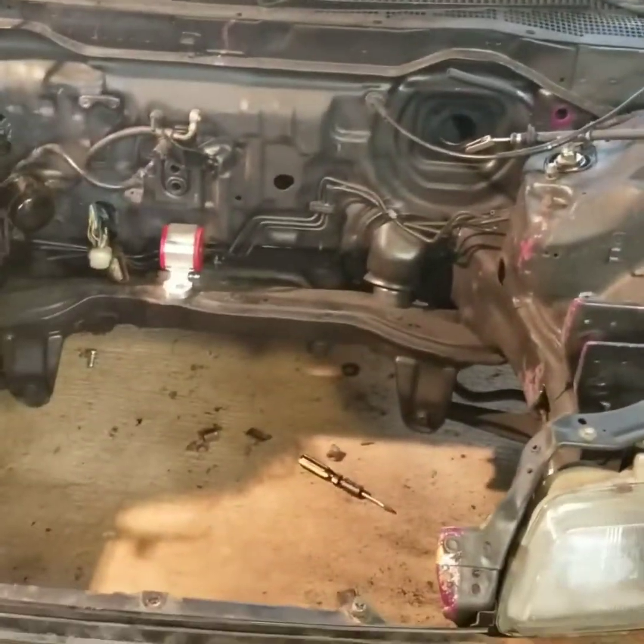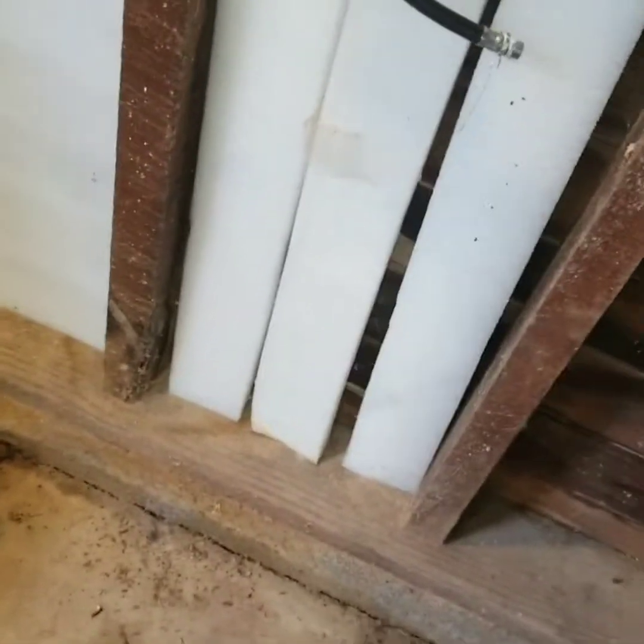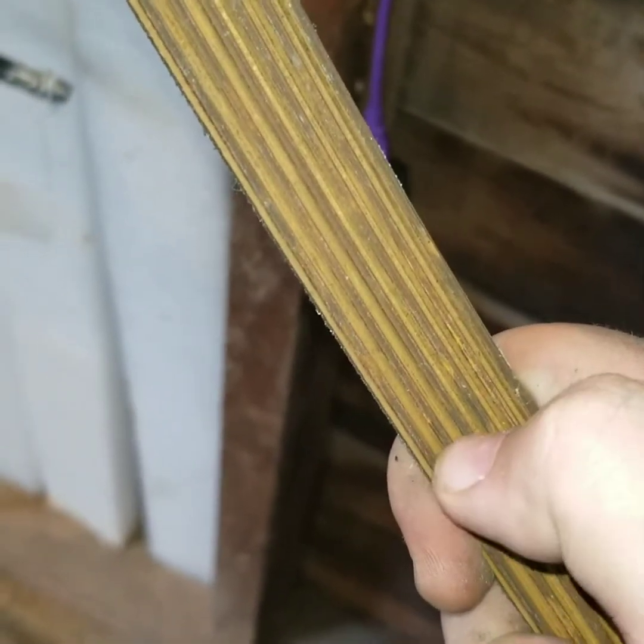No problem. I am ordering a VMS S2000 crank pulley. So that's actually thinner, I believe. It's a four rib. And we got the belt for this one over here. And this one is, focus, 1, 2, 3, 4, 5, 6, so we got 6 ribs. So 2 less ribs should be tucking a little bit closer to the motor.